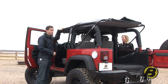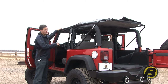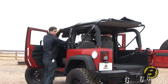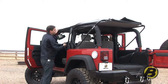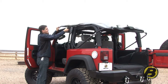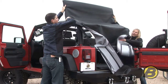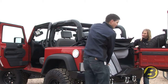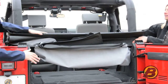Now we're going to take the top all the way down. You have to ensure that when we take the top down the tailgate is actually open. If you don't have the tailgate open we can actually damage the top, catching it on the tailgate or on the brake light at the back. Pull the sun visor back, release the header latch, and the next stage is there's a secondary latch on the door rail. Pop that secondary latch and then the whole top will pivot backwards. Bring the top down, managing the fabric as you do, tucking it all away. Keep it low, keep the visibility and keep the fabric tidy.